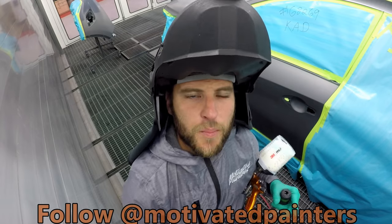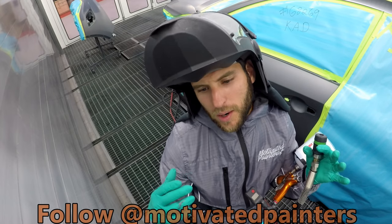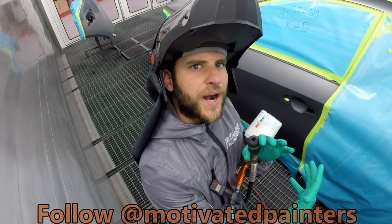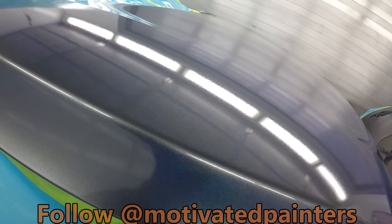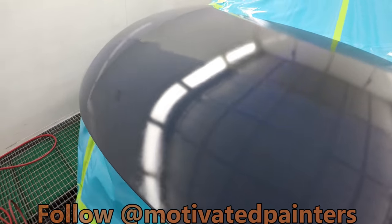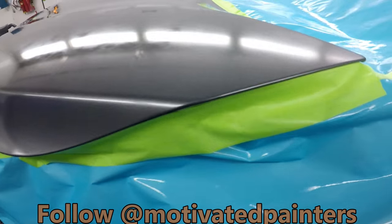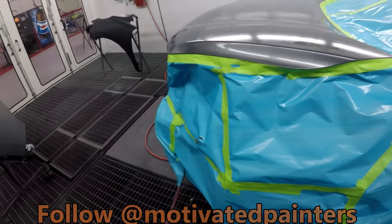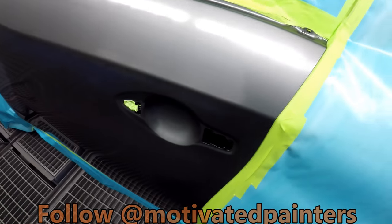And this is gonna help you with sand piling for those of you who are struggling with sand piling, but I'm gonna give you some more tips on how to spray to avoid sand piling. Okay, so as you can see, it's even. It's not like clear coat, it's even, right? It's not super wet, but you do wanna create an even layer, a nice layer over the substrate, whatever you're painting, okay?